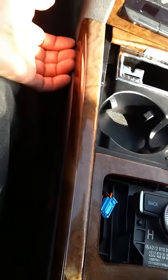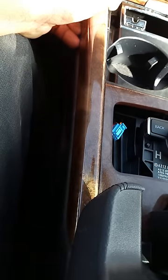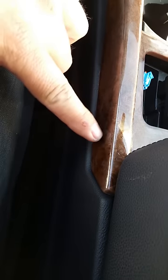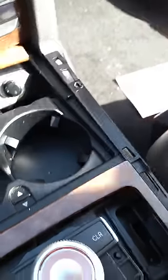Now you've got a couple of pieces out. The next thing is to pull up these side trim pieces. Just get your fingernail under here, or your plastic pry bar if you so desire, and lift up. It snaps here, there's a snap here, a snap here, and on the side it pushes inward, so you slide it forward and it's free. You can see that hook I was talking about. Do the identical move for the other side.